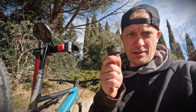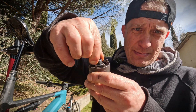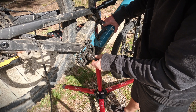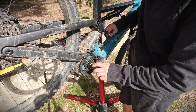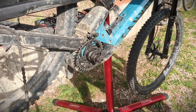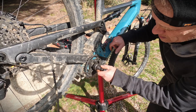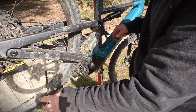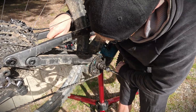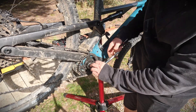Now it's time to use the special chainring tool. If you look at it, there's a screw-in part in the middle and teeth on the outside. First you push it through so it sits there, then screw in the tool on the normal thread. You screw it in, twist it, release it — so it's now on the piece. If you're sensible you should use a ratchet. As you open it that way it turns the chain, so you need to make sure the chain is on there, hold the wheel, and it comes off.